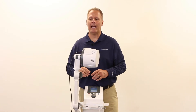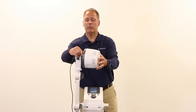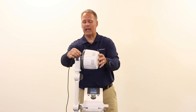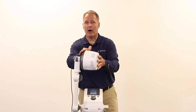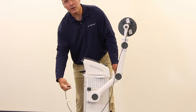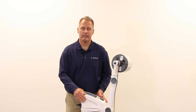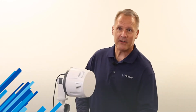Number two on the hot list of FAQs is the 'drum not detected' error. That is usually caused by a loose coaxial cable connection — since this drum spins around a lot. The simple solution is to turn counterclockwise to disengage the coaxial cable, then re-engage it — it can only go in one way — and reseat it into the back of the drum and also into the back of the unit, then restart your device.